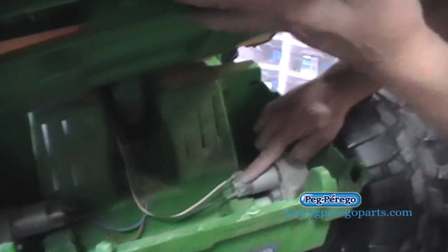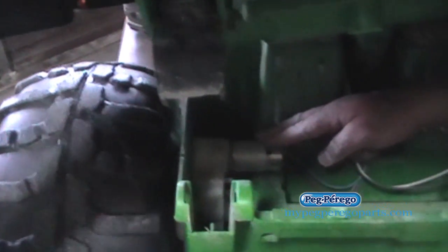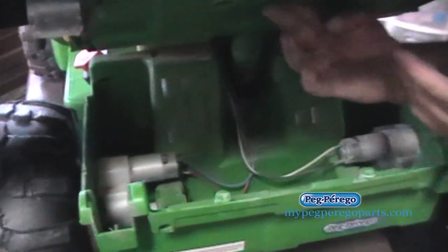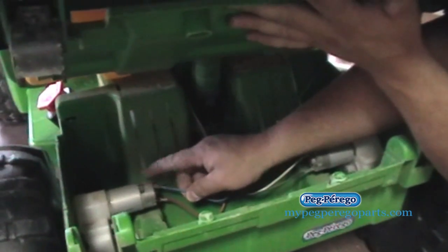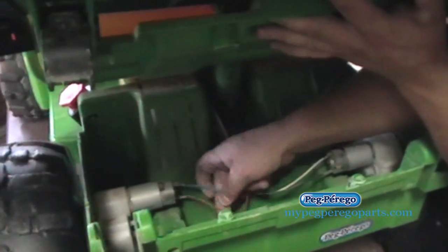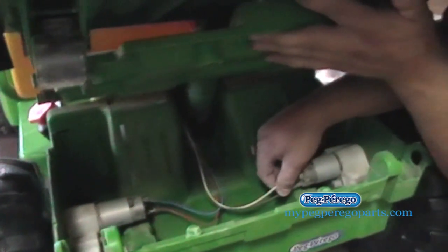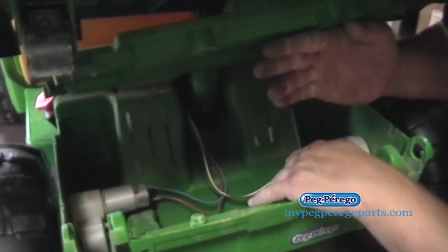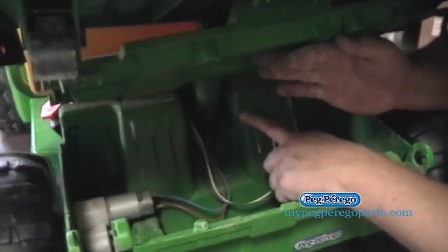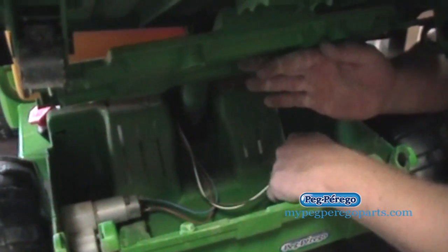Can you get those motors right there? Here's the right motor, here's the left motor. There are a couple of things you can do to determine if it's your motor or not. First, check the connections. If they're secure and only one wheel is spinning, go ahead — say this wheel was only spinning — we'd take these two wires off of here and switch them to this side, and vice versa, put these over here and switch them over. We want to see if these motors turn on at all. If they don't turn on at all, you either have a shifter switch or a foot switch problem that's not getting power back here.